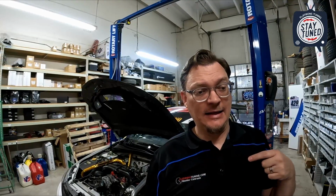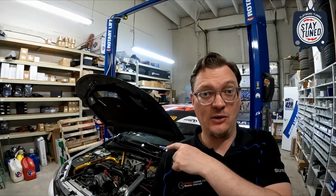Well, that's what we've done with our Pikes Peak car. And the reaction we get, a lot of times, even to this day, when we let people know that our race car here still has a stock Subaru bottom end, stock cylinder heads, D25 cylinder heads, stock cams, valves, the whole nine yards. At this point, we're on our fourth engine, but it's a Type RA block, 100% stock. There's a little bit of disbelief there.